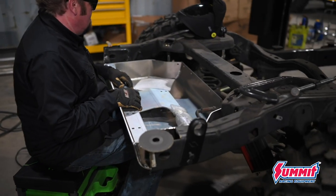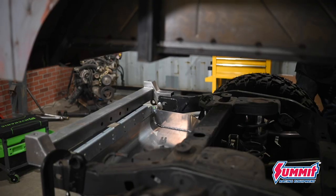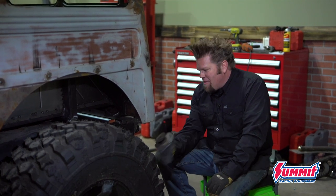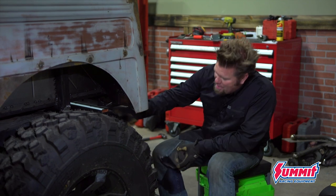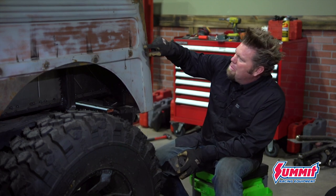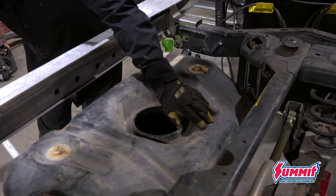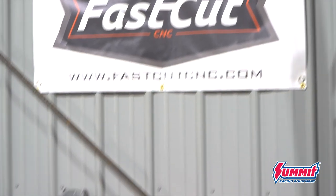It's like it's meant to be in the back of the JK as soon as you remove the body mounts. All I have to do is relocate the body mounts from the inside of the frame to the outside — they'll sit right about here. I dropped the body down to check the space for the tank and there's plenty of space. I'll even be able to run the fuel filler up over the top of the frame rail, and we can put a fuel filter somewhere up in here. The TJ gas tank skid is going to fit perfectly — well, you've got to chop up a little more of the frame to fit the Willys custom floor, but in the end it's going to be worth it.